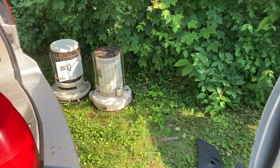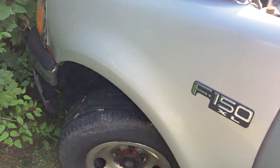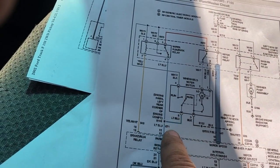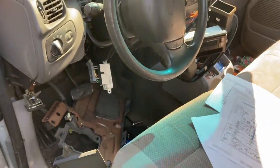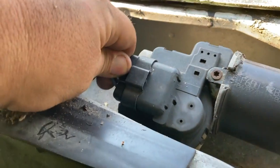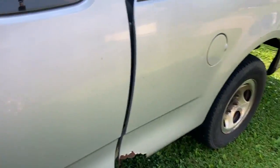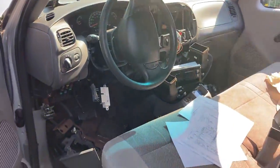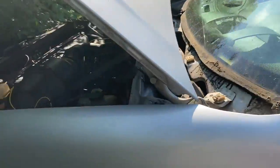Here's the moment of truth - is that back-feeding from the wiper motor power feed, coming around down to the wiper motor and back-feeding to the park sense circuit into the GEM module, causing the dinging effects? Is that what's happening? Here's the wiper motor - let me get it unplugged. And we have no dinging! We have no dingy ding. No power to the radio. So we have a bad wiper motor causing all those ignition problems and all those dinging problems. Isn't that interesting!